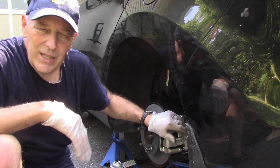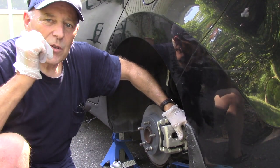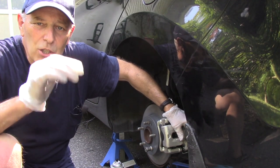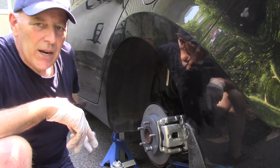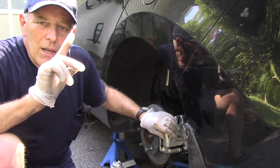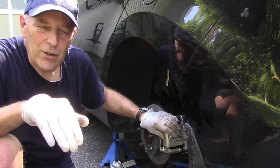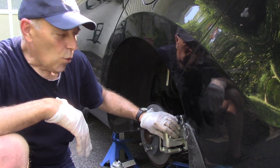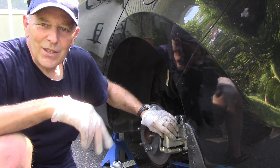We filled up our reservoir up front on the master cylinder to make sure the fluid level is where it belongs. We're going to put the wheels on, take the jack stands out from underneath the vehicle, and then road test it. When you're driving it, you're going to get a little bit of smoke — even though you cleaned it off with brake cleaner, you still have a little bit of grease in there. That's absolutely normal. This job is done and we're on to the next. Thanks for watching and I'll see you on the next one.